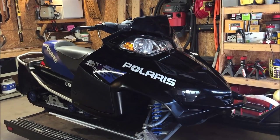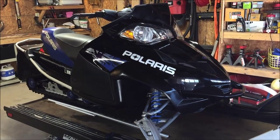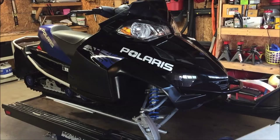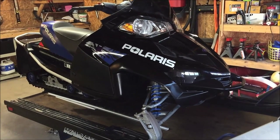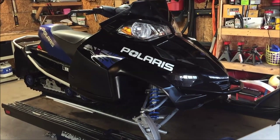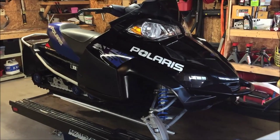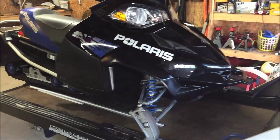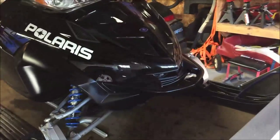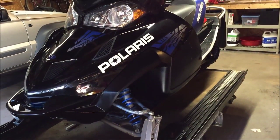You'll notice right away that mine is all black. The first step of the process was painting all the flares from the original voodoo blue to black. We used Krylon Fusion paint - taped everything off and went around the whole sled, painting all the blue trim, flares, and everything else. This stuff works very well; I've used it on other projects and had great results.